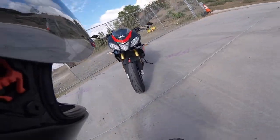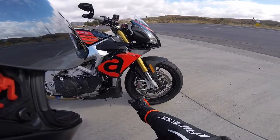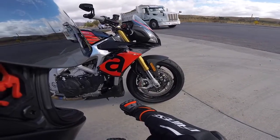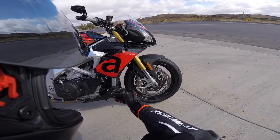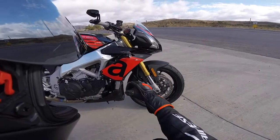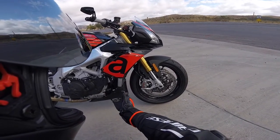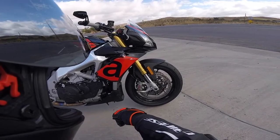The last modification I've made — you can't see it here, but let's just look at a pretty Brembo caliper since we're talking about brakes anyway. I changed the brake pads on this. When I first bought the bike it had a brake pad recall — that's a Brembo issue, not an Aprilia issue; there were Ducatis, Suzukis, multiple bikes by different manufacturers affected. I got the replacement pads, but I also cooked them at the track and one got worn out a bit crooked. So I cleaned up the pistons and seals on my calipers and swapped to the Ferodo equivalent pad — I'll drop the model number on the page. They're the OE replacement equivalent of the stock Brembo pad, but from what I've read online they last longer, grip a little better, and are just a better all-around pad. Got them from af1racing.com — that's their pad of choice — and I've been very happy so far.